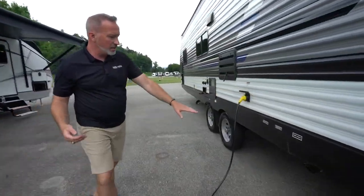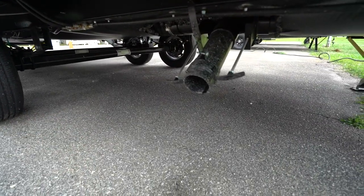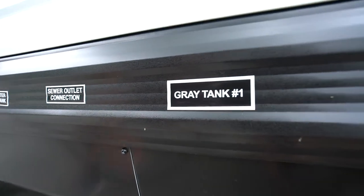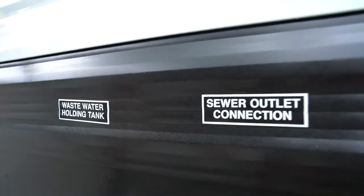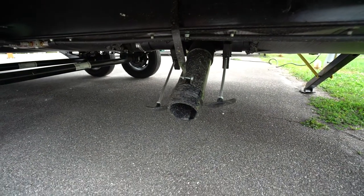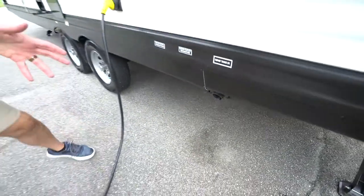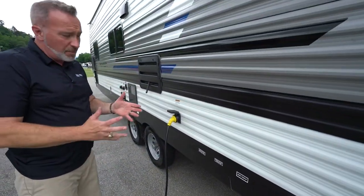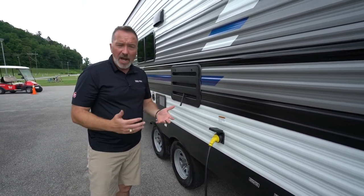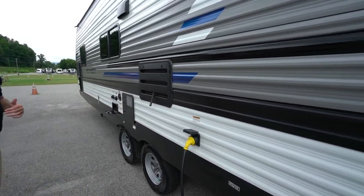Come over here to your terminations and you'll see the black tank and gray tank handles are usually labeled. The way you open them is you just pull them. You always want to dump the black tank first and then do the gray tank so that it kind of cleans out what's left. But if you're hooked up to the sewer at a campsite, it's a good idea to actually leave those closed because you do want some water in that black tank, or else you'll get what's known as a pyramid — the solid waste will stay there and collect and be much harder to flush out, even if you have the black tank flush.